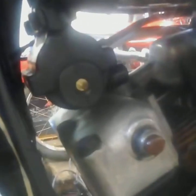Now, if you go around the other side of the coil here, there's a white wire right here that hooks up to this side of the coil. That's constant 12 volt, so the light should stay on all the time and you can test it for 12 volt, but that comes right from the battery when the ignition is on. So that all tested good.